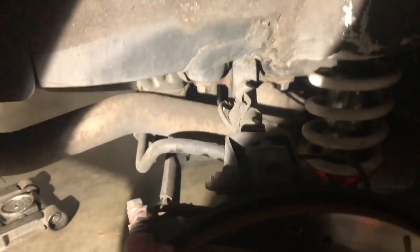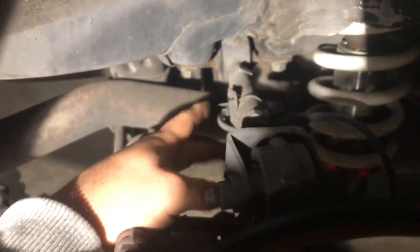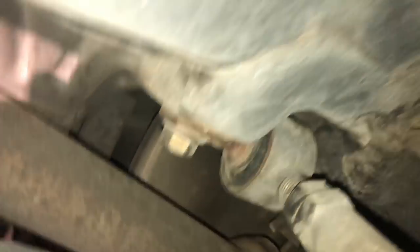Your friend's always the mechanic — he's an actual mechanic at the shop; we just do this when we're off. So we've got 3x17 millimeter bolts that we're gonna be using. There's a stock bracket that's supposed to be holding this but previous owners just had it with a zip tie. From the looks of it, it's a small bolt hole so it's probably just a 10 millimeter. Your two bolts are one here to the left and another one to the right.